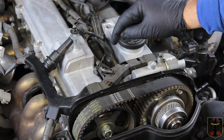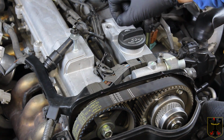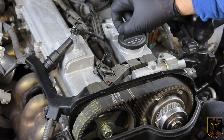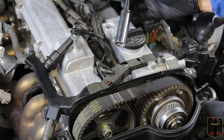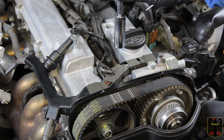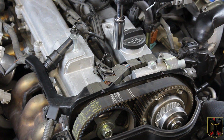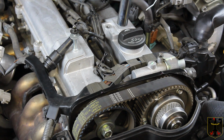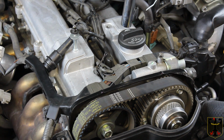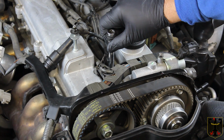Okay, we've started the first spark plug. We've put it in here. We used some special pliers to hold the end of the spark plug so that we wouldn't drop it, wouldn't damage the gap. And then what you do is you take a socket like this and you turn it very carefully to make sure you're not cross-threaded. If it gives you any resistance at all, it's probably cross-threaded. That's a problem, because if you cross-thread the spark plugs, you have to put a helicoil in, and it's really a big effort. So what we've done is we actually have it snugged up.